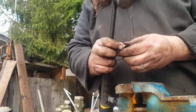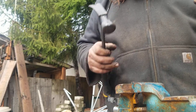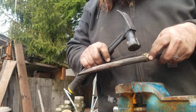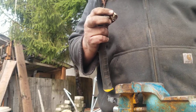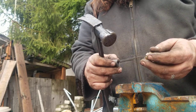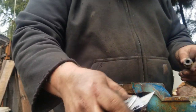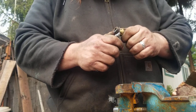That comes up real easy. You might have one that needs a little bit of dressing, and you use a little bit bigger taper for that. The trick is to put a little piece of rubber in there — that keeps you from flattening the barbs on the inside. Just a couple of taps; I wouldn't use a framing hammer, but that's what we have on hand today. I've got to fix my other hammers — somebody keeps breaking things.